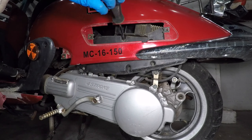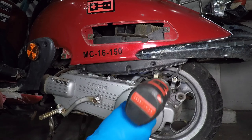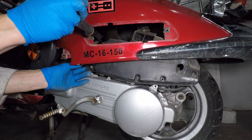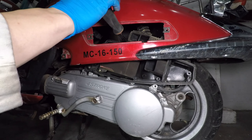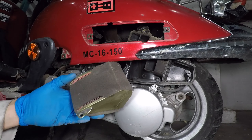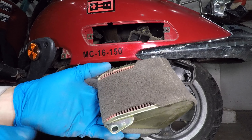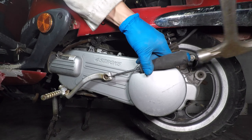I have a few more things I want to inspect on this scooter. The air filter is behind the fairing and they give you this access panel. The only problem is Chinese scooters aren't actually that well designed and getting to the air filter is a weird and cumbersome process. The air box is big and has a million screws that you can't reach. Here it is — it's a paper filter with foam on top and it's pretty clean.